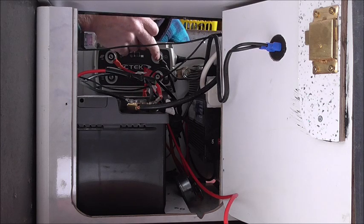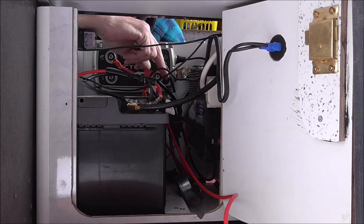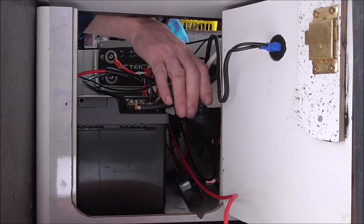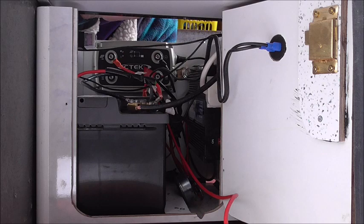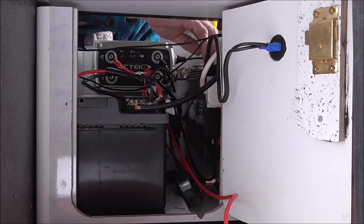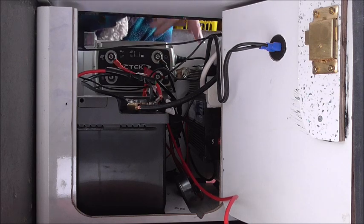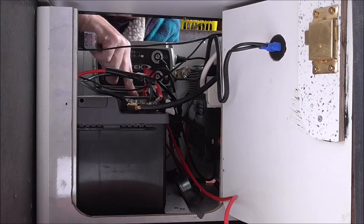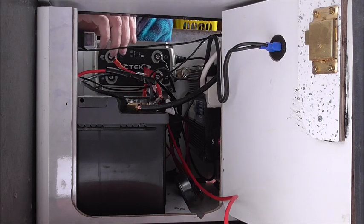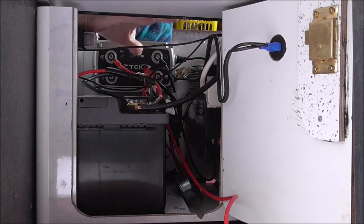Then it comes out of the CTEK and goes to the battery which is here. We then have a negative which comes from here — it can go to the chassis, but in my case I put it straight to the battery; no problem with that. The battery is then connected to the body with this heavy duty earth block. That really is the charge side of it sorted. Then we've got the inverter — it's only 600W, but it's more than enough for what I need. That just connects straight to the battery live and negative. The auxiliary fuse box just connects straight to the positive on the auxiliary battery, and I've connected the cable from the negative to this tail block. That basically is the charge system sorted.